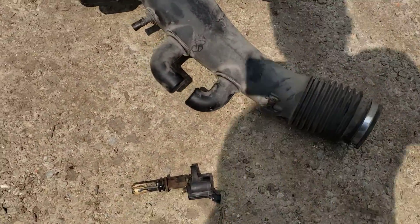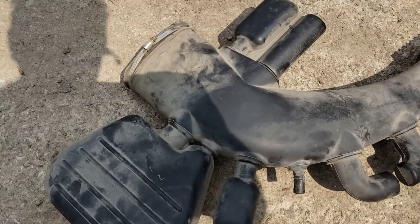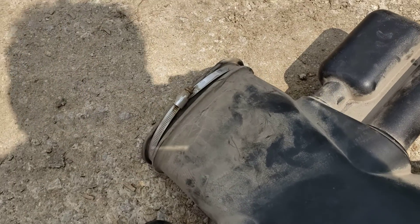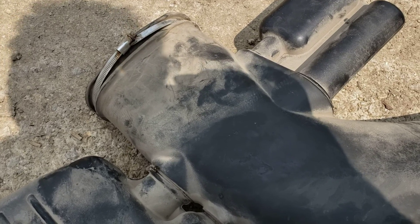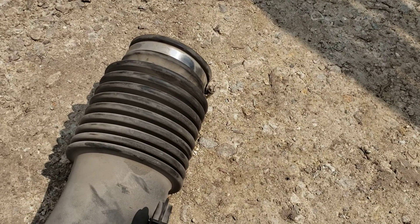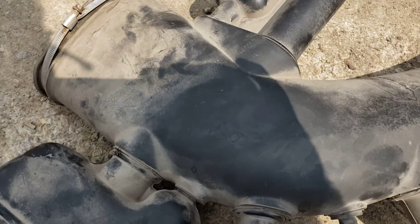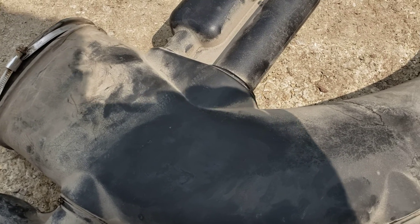What I did is I took off this air filter assembly. This particular bolt was kind of way down on the side, so it was difficult to get it loosened, but I was able to loosen that and recenter it for easy access on the next disassembly. Then I just loosened that clamp there, and there's a hose that went on there, so this whole assembly right here just pops off, which makes getting to the spark coils extremely easy.